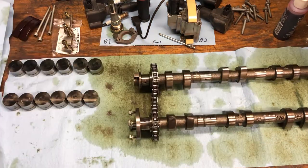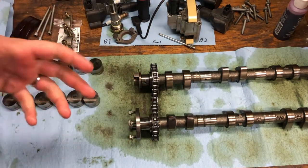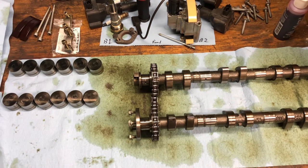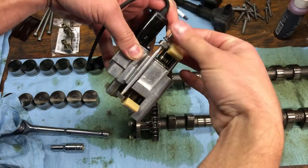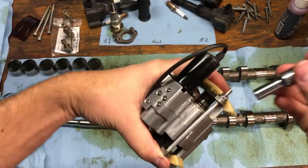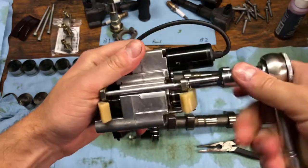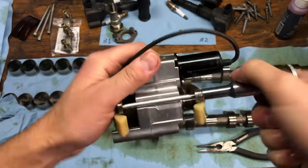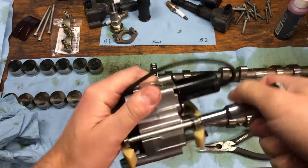Now of course there's more to this. So what we'll do is take our VarioCam solenoid, put it back in between, and then we can set the entire assembly into the engine and clamp it down with our cam caps. Then we'll truly put it in time relative to the crankshaft using a special tool. By the way, it's reverse threaded, so we're putting this in — reverse threading it in, getting it down in there as far as it came. We'll tighten the nut down a little bit. Now I'm going to turn this down, which compresses our entire solenoid, so that it's that much easier to get installed.